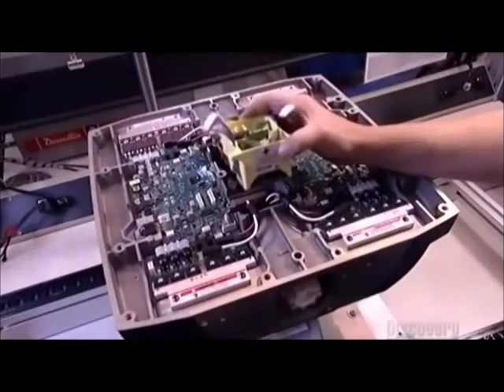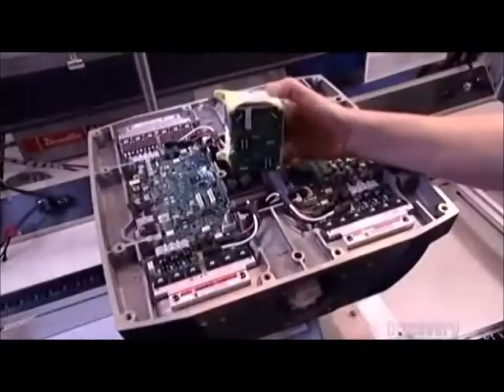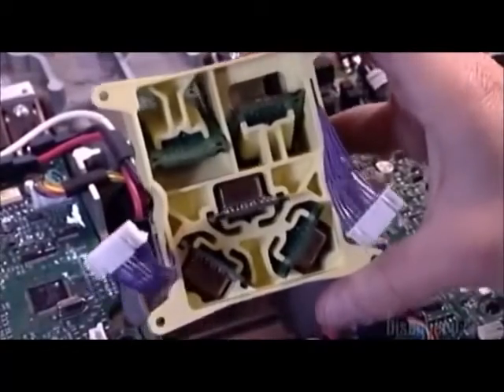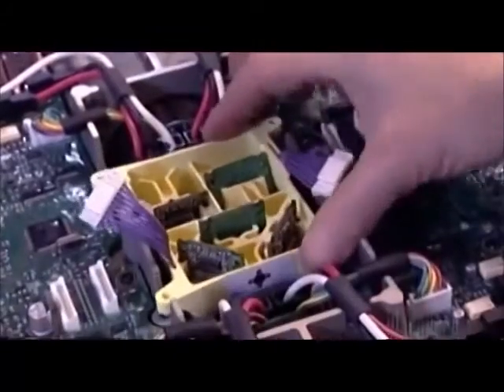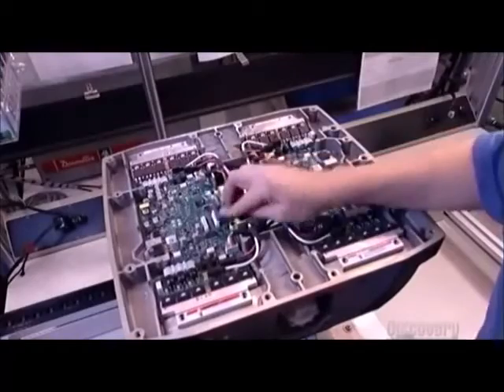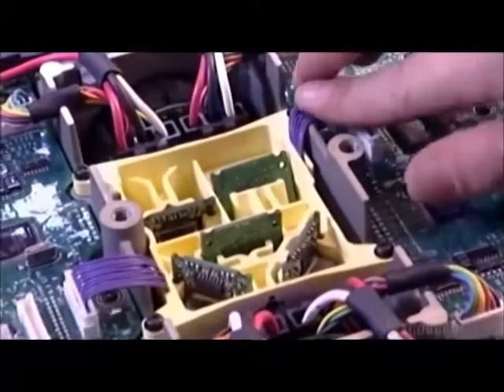Then she adds what's called the balance sensor assembly. This includes five gyroscopes and two components called fluid tilt sensors. These instruments gauge the vehicle's position relative to the ground. The controller boards check these instruments 100 times per second and adjust the vehicle by rolling the wheels forward or backward when the rider leans either way.